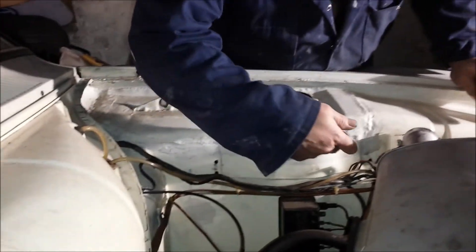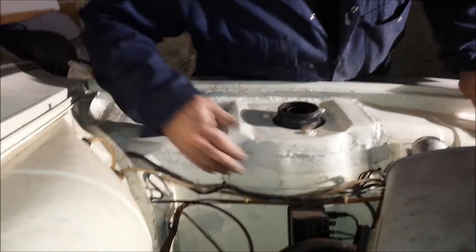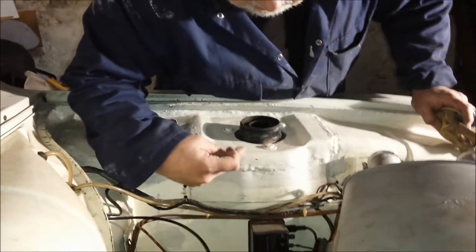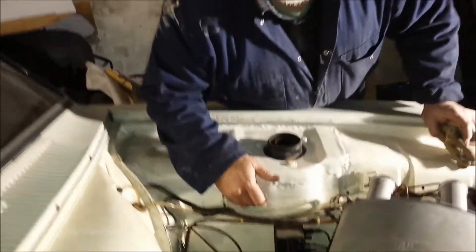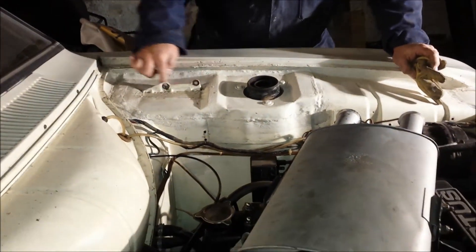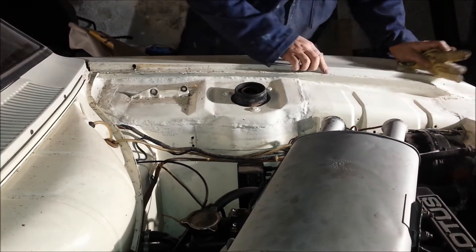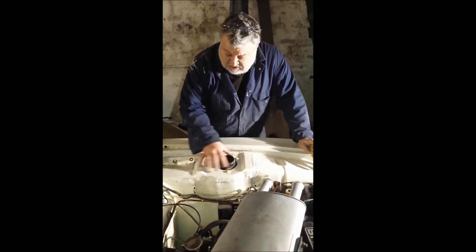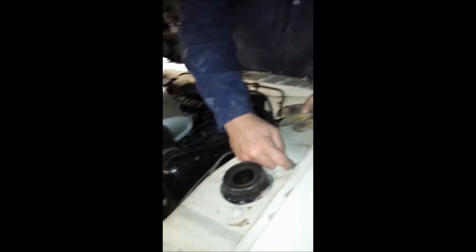You can see where the new welding has been done here and the top McPherson strut plates have been welded on. Here's the original edge of the McPherson strut cap and what we're trying to do is make this section all the way around — whatever the weld looks like — match the original profile. Around the backs of these hinge retainers there's a gap that shouldn't be there, and basically the tops of the wings have got welds in the wrong place, so we'll have to be tidying it all up. All of this white is literally flaking off — on this side it can even come off with your thumb, so that's going to have to come off anyway.